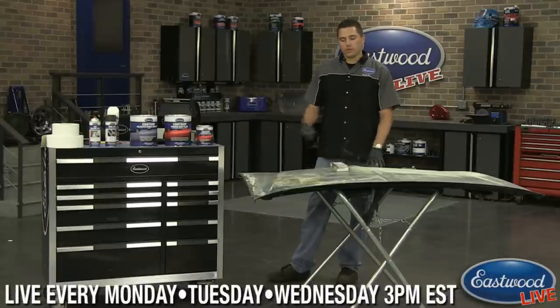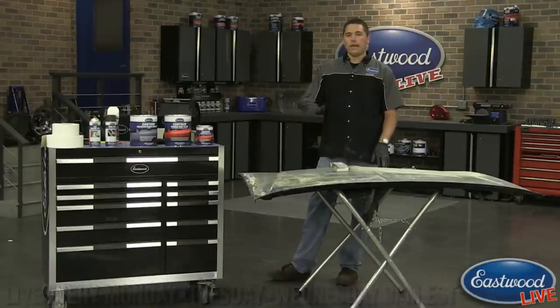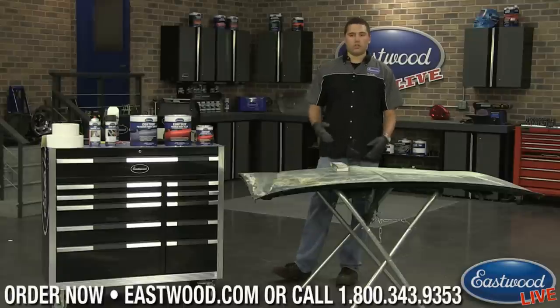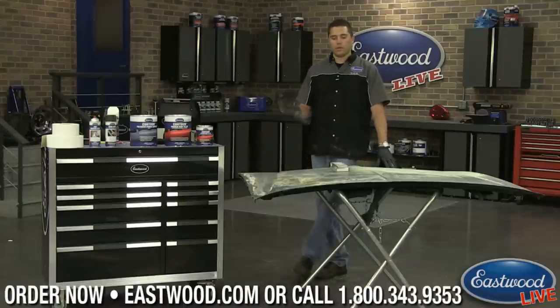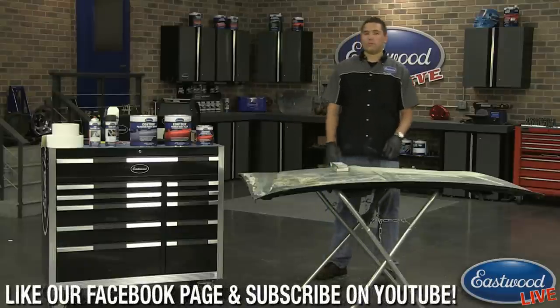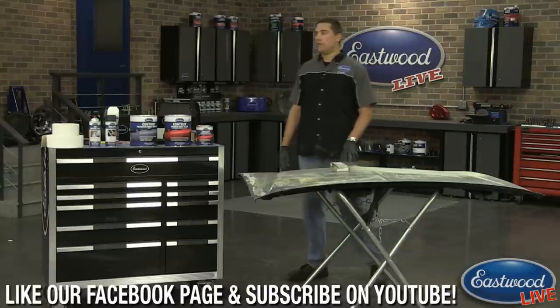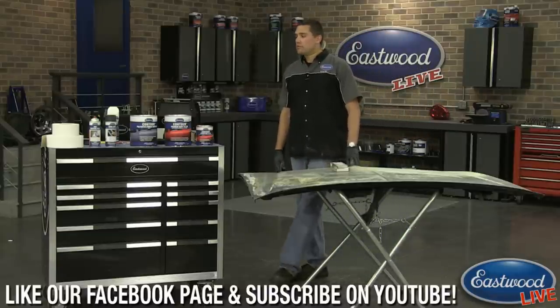So by the time you're done doing those three coats, if you reduce it too much, it might be the same as a guy who sprayed it with a 2.2 or a 2.0 and sprayed two coats on. So you might be behind, or you might be only equivalent to half of what he was. So to give yourself that build, try to keep it minimal, but certainly a 1/8 is acceptable. Again, it depends on the conditions of the day.